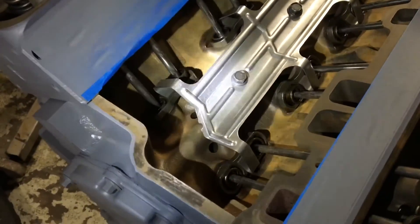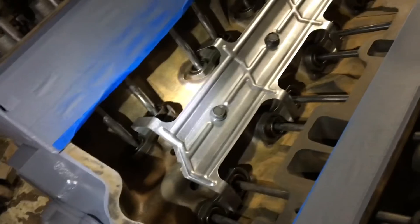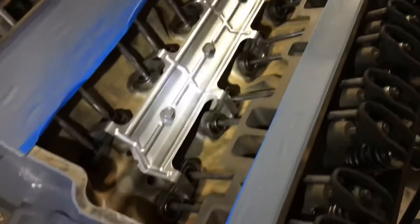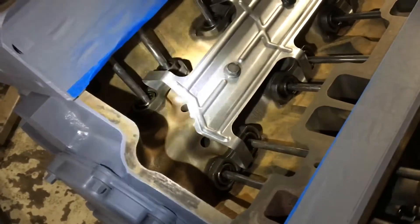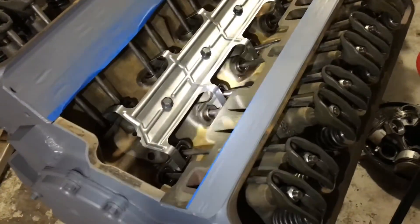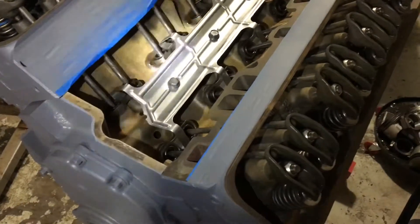That means the lifter has to be replaced. I don't take them apart and try to service them - they're about $10, it's not even worth my time to fix a lifter. I just go to O'Reilly and buy another. I think Sealed Power makes one - I'll put the part number in the description, but it's about $10 for a new lifter. All these are used lifters out of a junkyard, so I need to inspect them and make sure they compress about half the travel like they're supposed to. I'll chase the firing order and check the condition of these used lifters as I go.